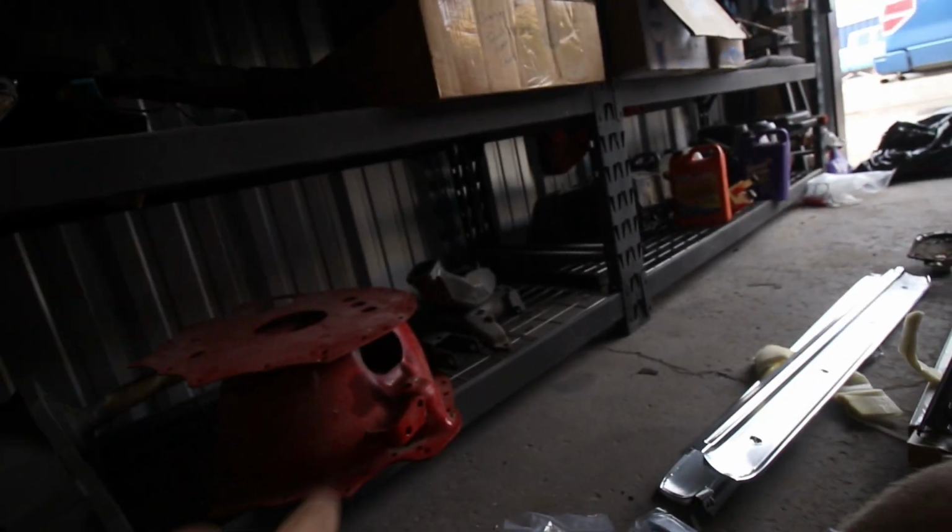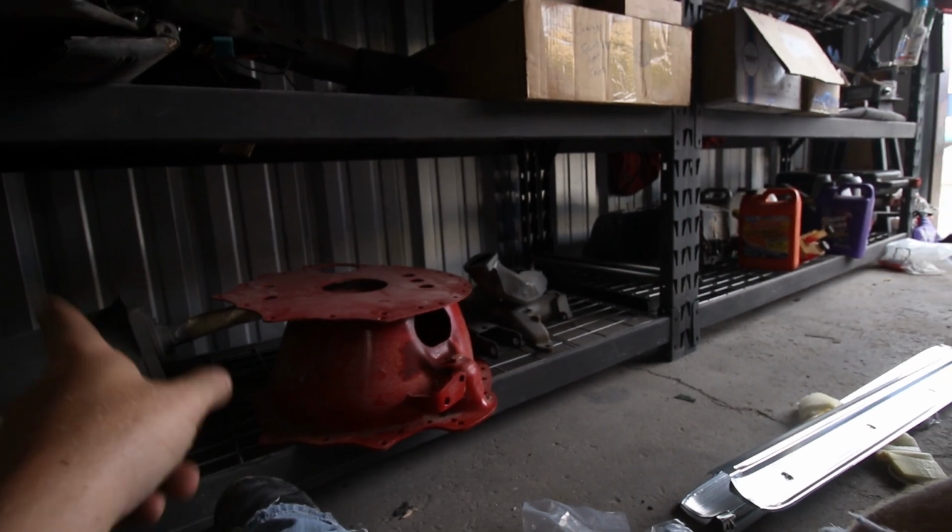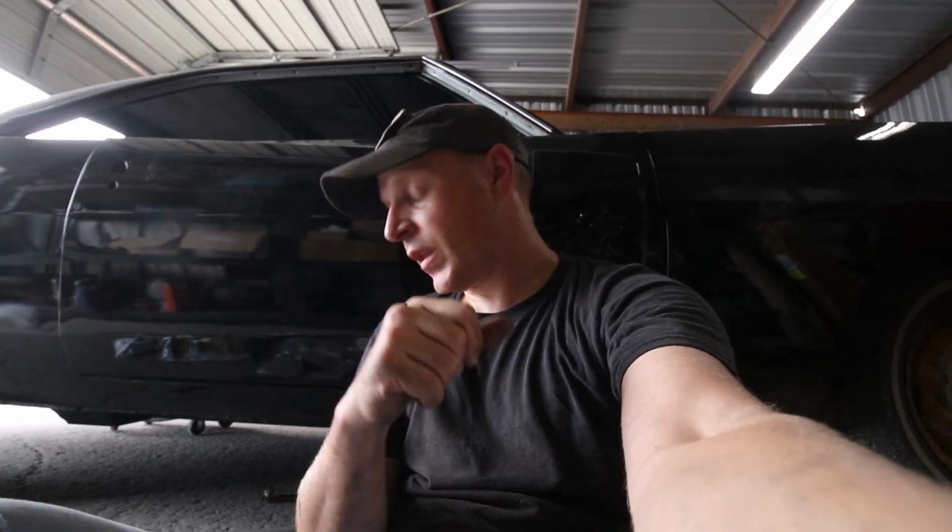So, the back of the motor won't shift back, obviously, because I have my scatter shield and my transmission not hooked up. So since it's only pivoting on two front mounts, the motor's going to naturally want to tip to the back of the vehicle right now. I don't want it to interfere with the wiper motor. So I'm going to put a small jack underneath to keep that motor tilted forward where it's supposed to be until I get everything hooked up.